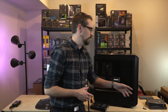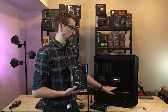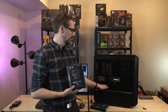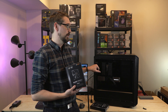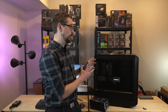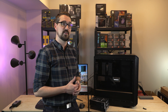To alleviate that problem, we're going to use two Silent Wings 3 1000 RPM fans — a little quieter and the same model as the front fans on the case. We're going to put those on the bottom of the case to draw fresh air in, which should get rid of the hotspot void and allow fresh air to flow through the entire case. We'll also have more cool intake air to offset the higher RPM exhaust fan. Hot air will naturally rise and vent out the top and rear. I prefer positive pressure so we're not sucking air in through unfiltered areas.